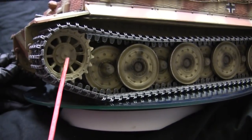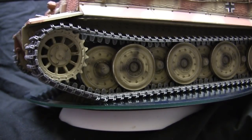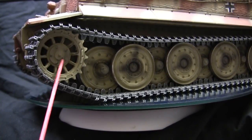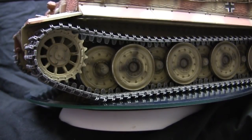The detail hub here is the stock unit and was mounted in place with just a little drop of Elmer's glue. You don't want a more permanent adhesive like CA because if you ever need to access this piece, removal of the hubcap can be problematic if held with a strong epoxy or super glue. You also don't want to rely on friction alone, as during operation or off-road driving the piece can easily wobble out, leaving you trying to track down a replacement part in the grass.